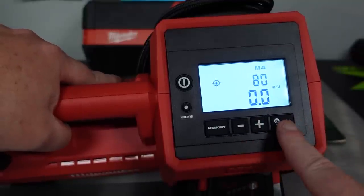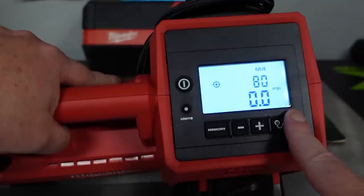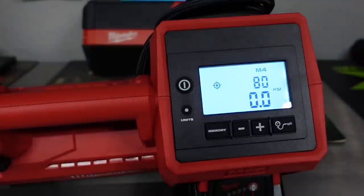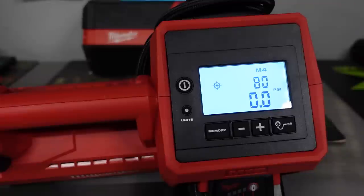When you want to start or stop the unit, just press this button right here. During this time, once it reaches the 80 or 50 PSI — whatever your target is — you will notice the target will start flashing for around three seconds. This is making sure you are at the target PSI; it reads the tire pressure again. Then if it is off, it will continue to air up the tire until it reaches that target. Once it reaches that target, it will stay non-flashing and you know your target PSI has been reached.